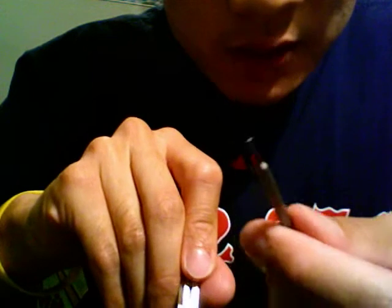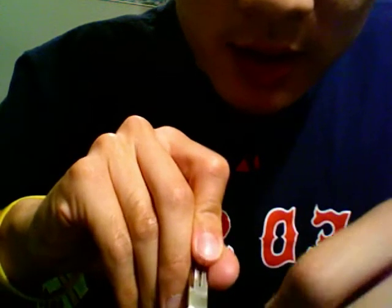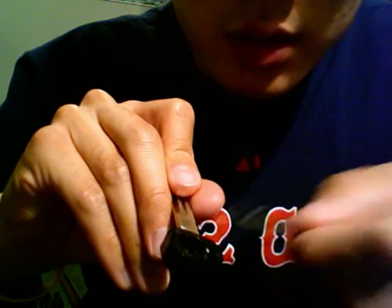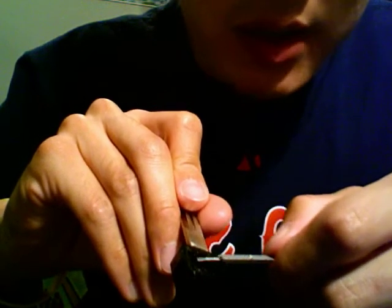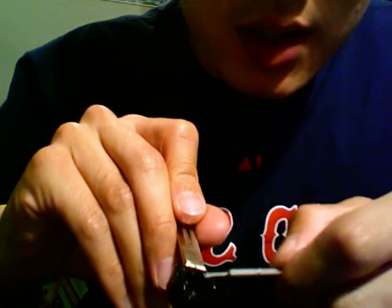So in order to get that out, take one of these flat, slotted screwdrivers, stick it underneath. There's going to be a plastic cover that comes off. Rip it off. There's a little bit of Honda Bond on here, so it's a high temp silicone, just like a rubber compound that holds it together. It's not very strong, but it's a little gunky, so it's going to take some work in there.